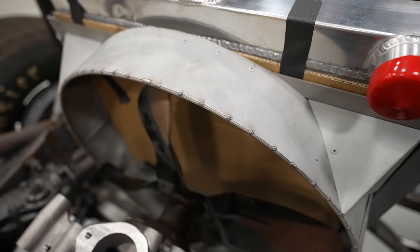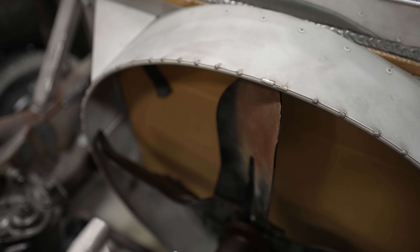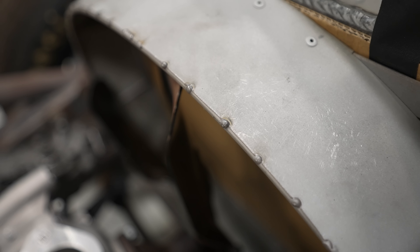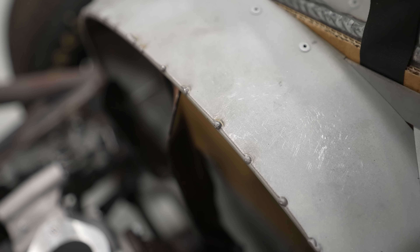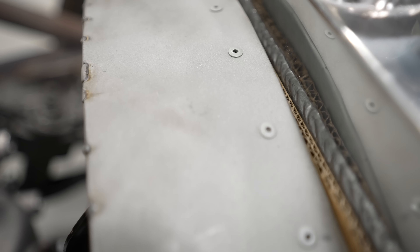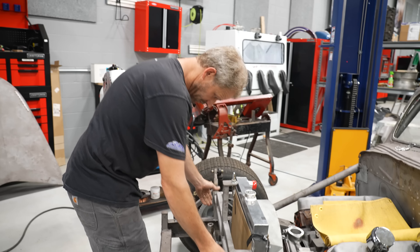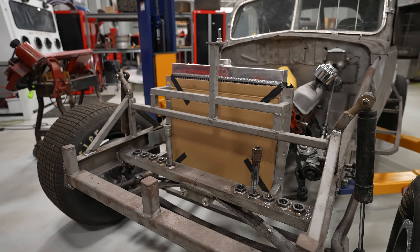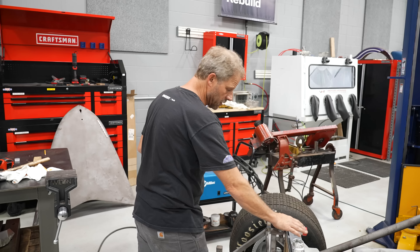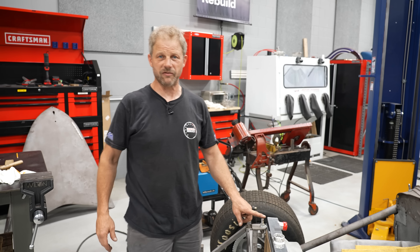Put your fan so it's not gonna hit the radiator, and you want about the center of the fan blade hanging in and hanging out — that way it offers as much draw as possible. Good ductwork, and he did a nice job — period correct, just some spot welds and rivets to hold everything together. It will be fantastic. And this is now removable — two bolts and this pops out — so the motor and trans will come out a whole lot easier than before, where this post was right in the way and made a draggy spot for the oil pan when it came out.